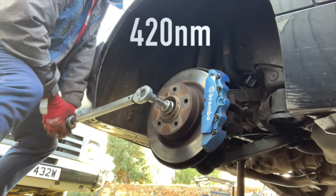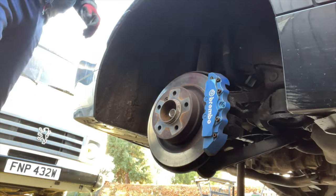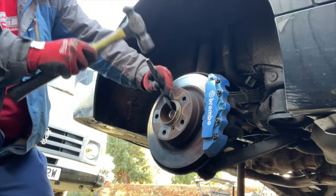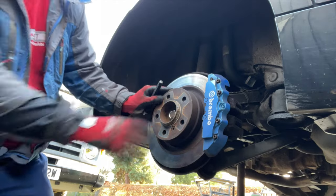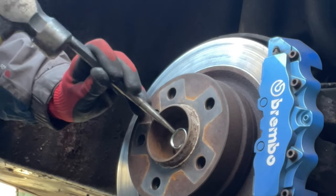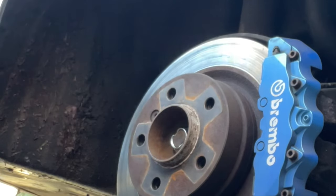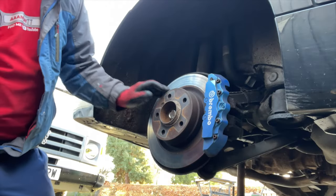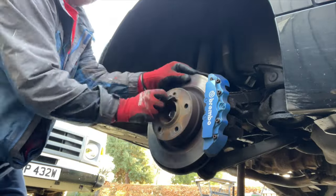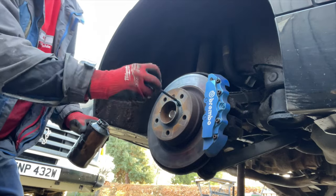Foot on the brake. Beautiful. Just give them a good bash down, one either side, and then that's not coming undone. Just knock it in there and give it a good bash. Perfect. I've just got to clean up these hubs just where that corrosion is — give them a quick whiz round. And I'll drop a little bit of aluminium grease on there to save us sticking in the future.